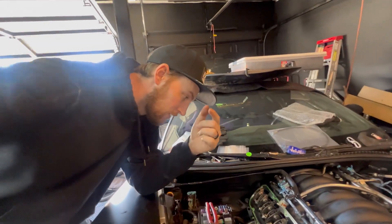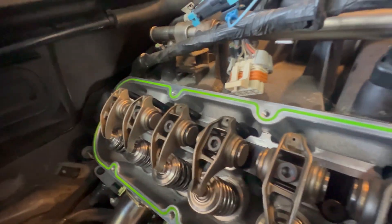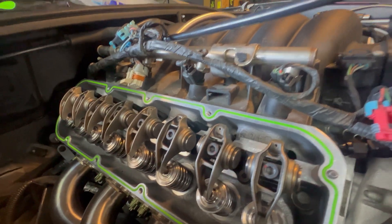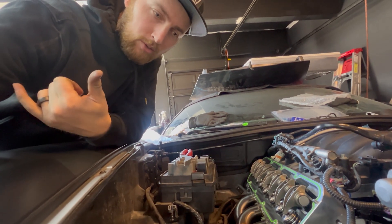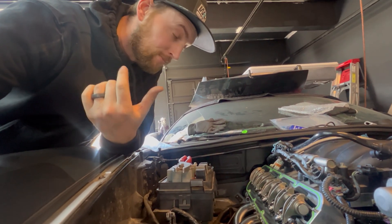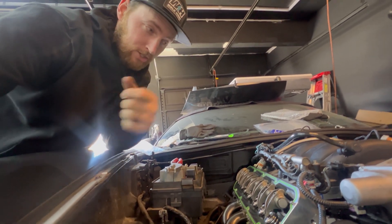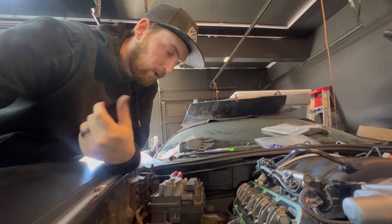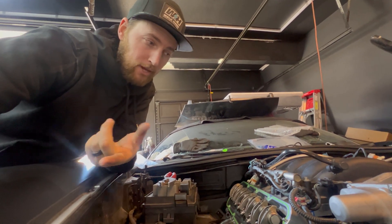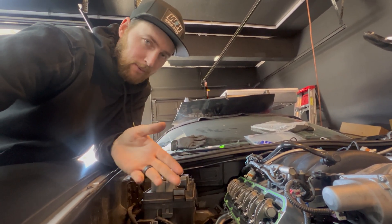Finally got my push rods. I just went and put in most of the rockers. I did LS7 rockers with a trunnion upgrade — it basically takes the needle bearings out of the rocker and puts a bronze sleeve in there. LS7 rockers are super duper light. At some point I'll change to a solid setup, but I wasn't 100% sure if this was getting boosted or if I was going to do a bottom end and raise compression. So this is a great setup — probably the lightest setup I could have done for now.